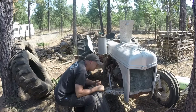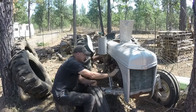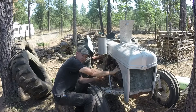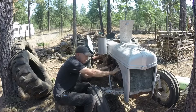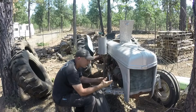I think it's time I finally get this done. The only reason this tractor, this old Ford 8N tractor, does not run is because this generator here has gone out. When I first got the tractor, I don't know, six or seven years ago — way before we moved up here — it ran fine, it charged up, it ran fine. Then it sat for a few years, I went to fire it up, charged the battery up, got it fired up, and it wouldn't stay running. It only ran for a couple minutes. I did a couple tests and figured out that when it's running, if you put a multimeter on it, you just watch the voltage drop — so it's not charging.